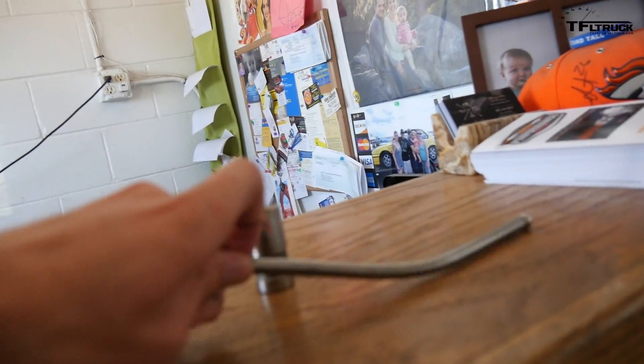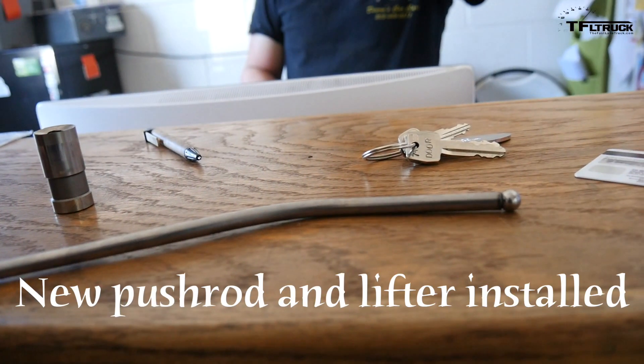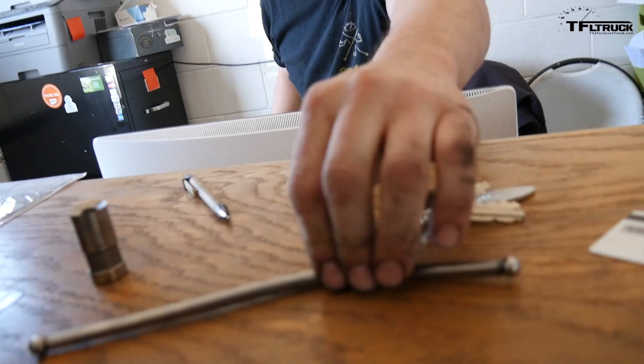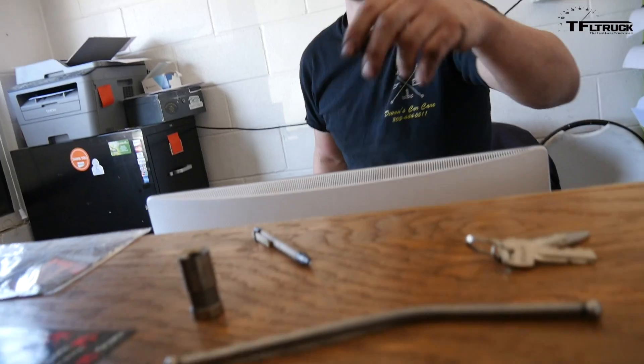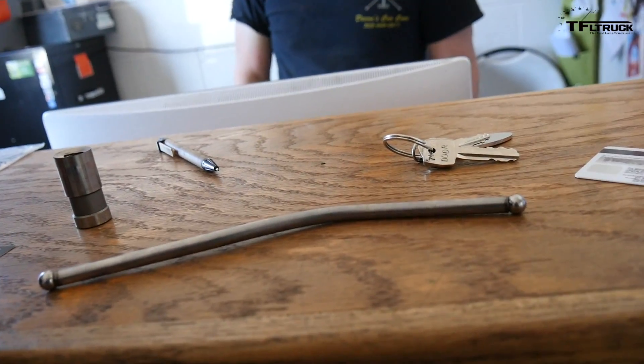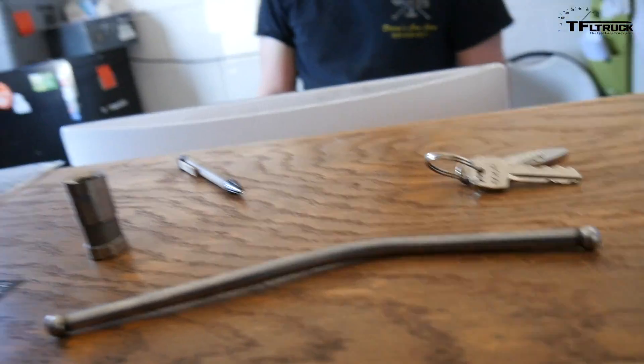So, lack of lubrication. I'm guessing there was either a defect on the camshaft or something like that — so it'll happen again. Yeah, this is a band-aid essentially. Andre, look at this push rod — that should be straight, it's kind of bent. That was the exhaust valve on number four, the last cylinder. And the intake valve is the one that had the bent push rod. So these were both on the same cylinder — this was the exhaust and this was the intake. The intake was trying to open against some compression. I've never seen one worn down like that.